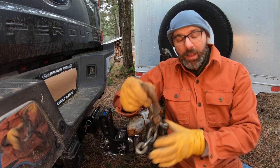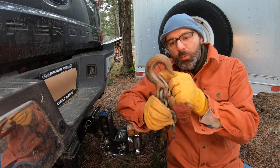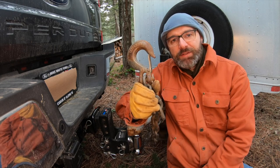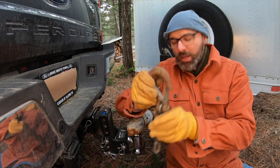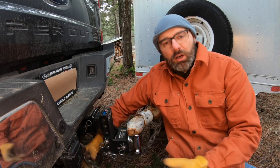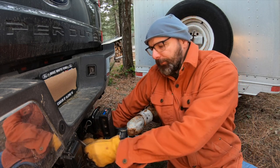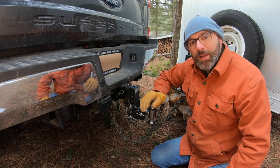While we're talking about hooks, I like these hooks with the snappy safety catch on them. If your hook doesn't have a safety catch, it can bounce in and out and off of your hitch — and that would be a bad thing. In order to work properly, the safety chains on your trailer need to be as short as you can make them within reason.